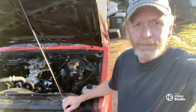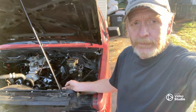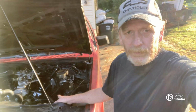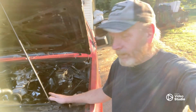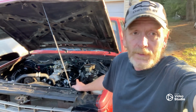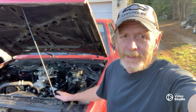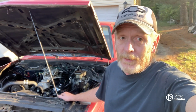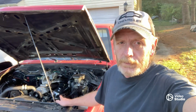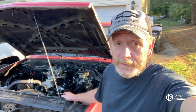This video right here, sorry about the sun, we're going to discuss these four-wheel drive headers and how I put them on this two-wheel drive 2.8. The 4.3s or 3.8s and stuff like that, you can swap these out with. You can buy headers for them all day long, but a standard two-wheel drive header for a 2.8, you can't. If you can find them, somebody say something in the comments, because I never could. There are still quite a few four-wheel drive headers out there, but they're getting scarce. So that's what you're stuck with if you're working with a 2.8.